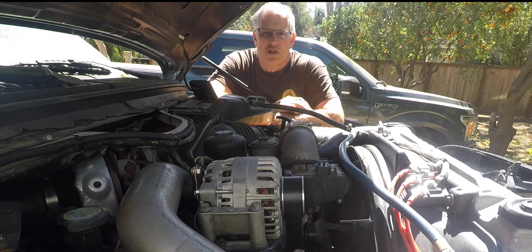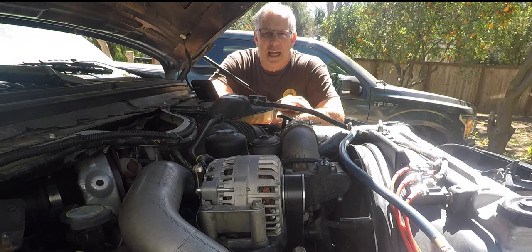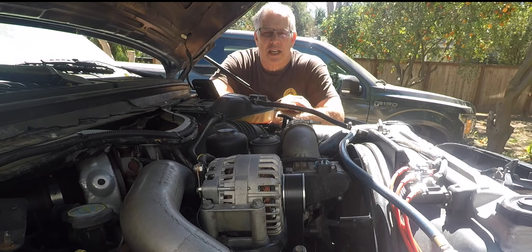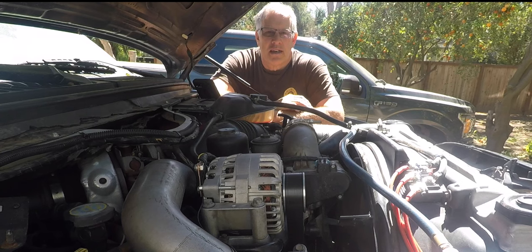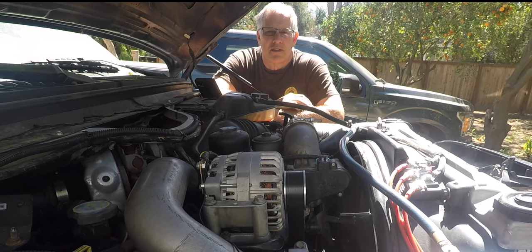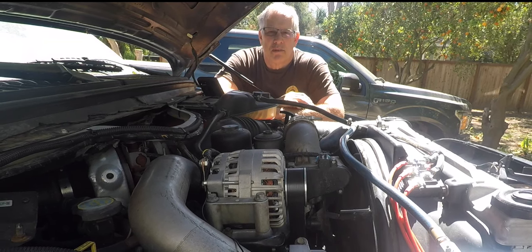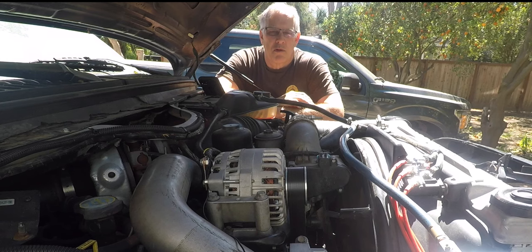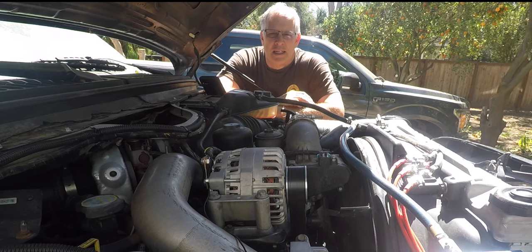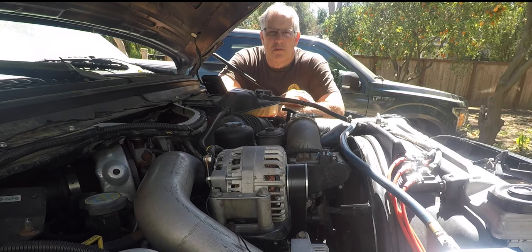When I say hot, I mean 120 degrees centigrade. That's about the maximum I ever want it to be, but just in order to get the charging done that I wanted — 90 to 100 amps — 120 centigrade seemed a little bit of a stress on the alternator. So I decided I wanted to try to make my system more robust, possibly even provide some more capacity.